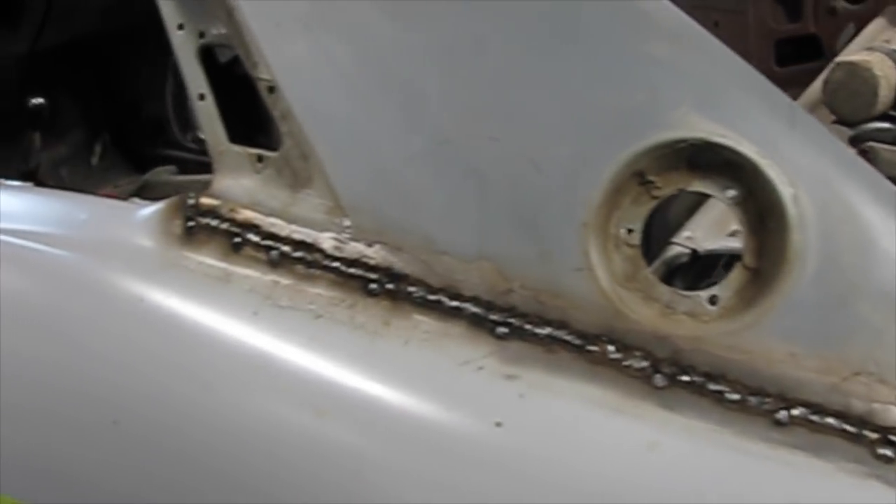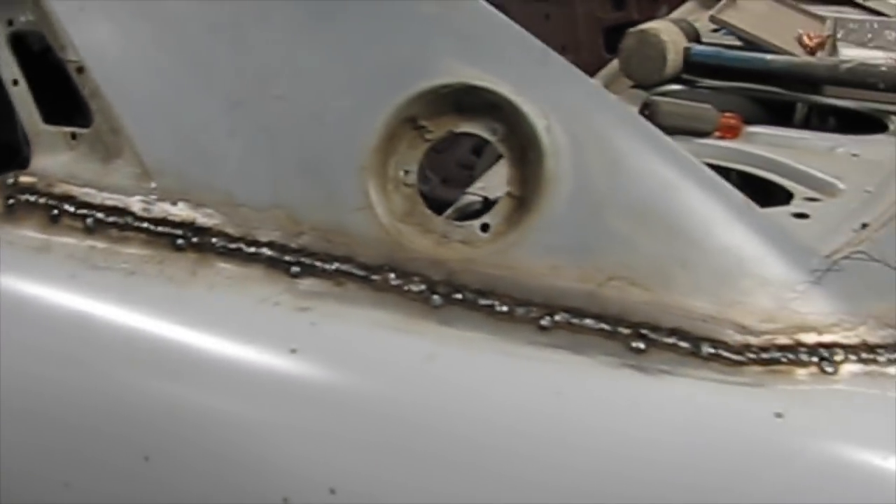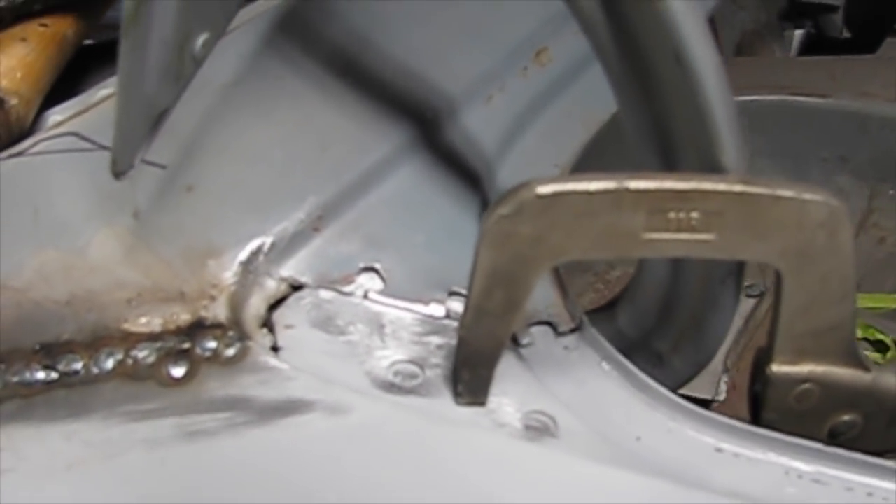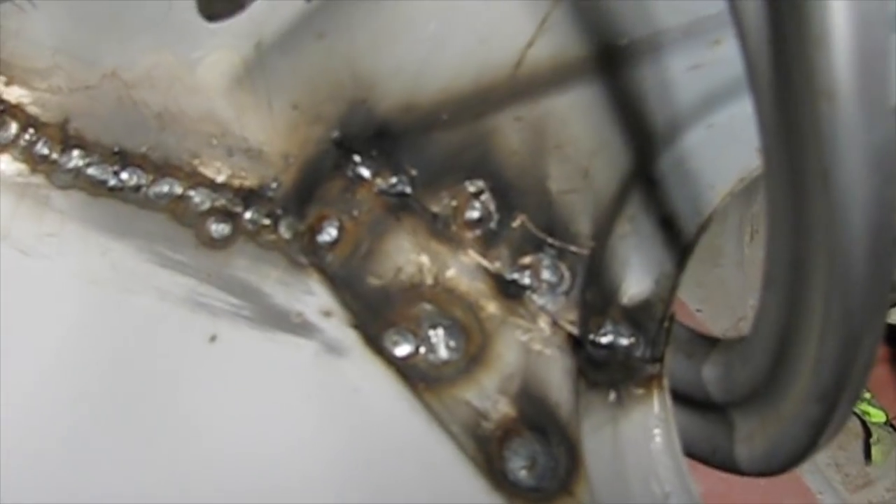Now I'm going to grind it down once I get the whole quarter installed. In here I've got five slot welds and then I've got to weld this across here — that's the next part to tackle. This is done from here right across now, so the top part is held in place and welded solid. These additional welds are going to be my next spot to tackle.